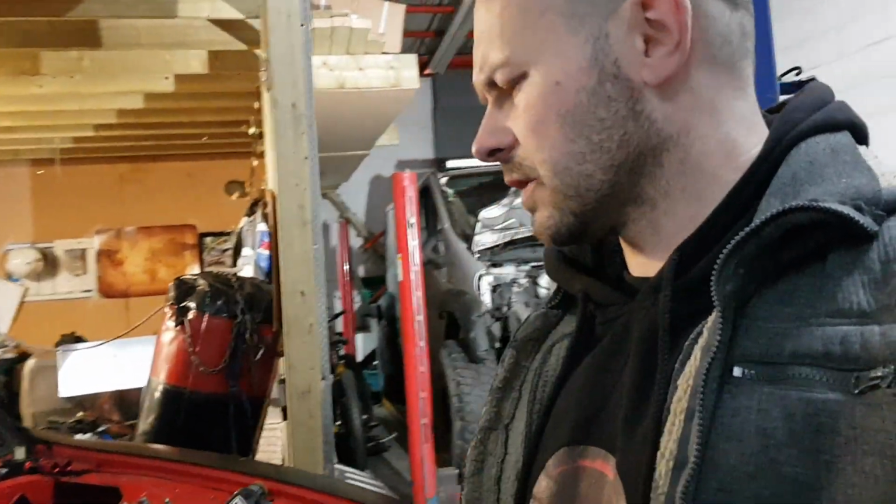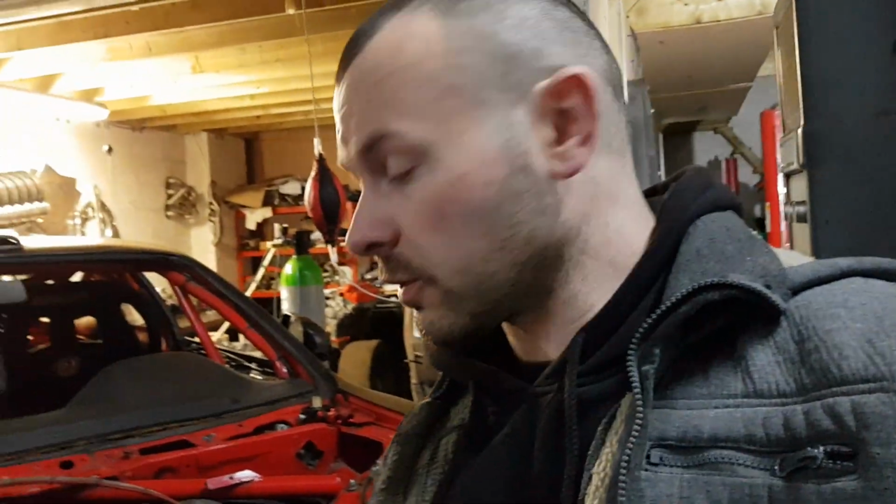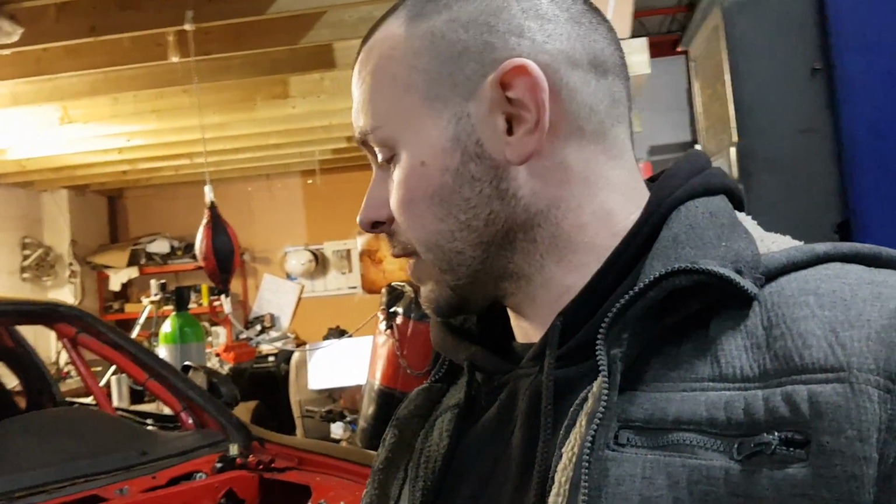Obviously, we're talking extreme results, which is good for a race car. To keep it completely reliable, I would stay at about 350, 400 brake horsepower. And again, tons of torque, which is way more than that engine produces, so there's no compromises. The only compromise with this engine is obviously your MPG. The fuel consumption is going to be much worse with this. But to be honest, forget it. I prefer to spend £100 more on fuel and have peace of mind on this.